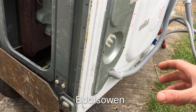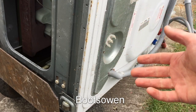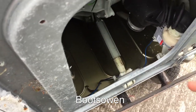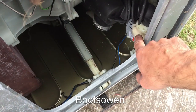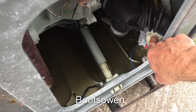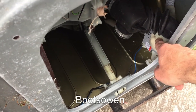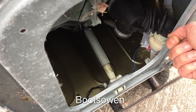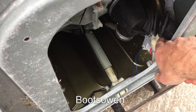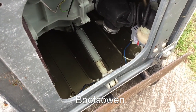If the machine's not pumping out, it could be that that basket's full of stuff. It can have hair clips, coins, and all sorts of things stuck in it. And if it was stuck full of fluff, there could be fluff going the whole way down to the pump. If this pump has stuff stuck in it, you'll need to empty that out too. You just stick a screwdriver down in there, burst this clip open — they're typically reusable, so you just need to push something down and twist it and it pops open. Pull this hose off, and if you can see in there into the impeller blades, then you can clean that out as well. I've shown how to do that in other videos.